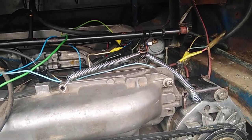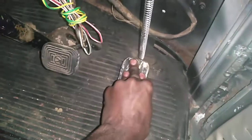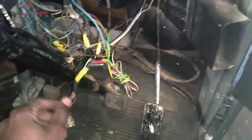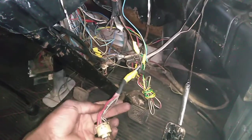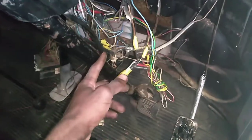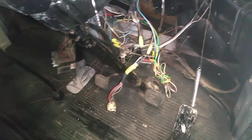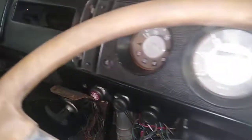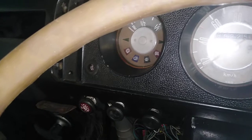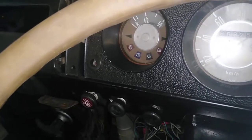Even in front I put a spring - let me show you. There's a spring in the front so that when you press the accelerator it comes back again. Then the other thing I was busy with is the wiring - nothing was working here. The ignition was not working, the indicators were not working, the oil switch was not working, the alternator was not working, and even the cluster wasn't working. There's no battery right now but I can show you it's working - we have an oil light and a generator light. Still have to fix the lights and indicators.